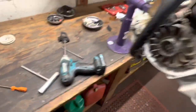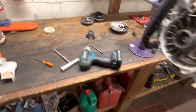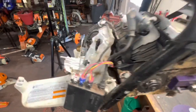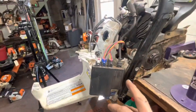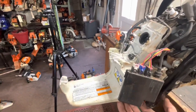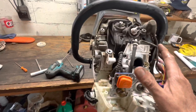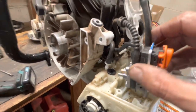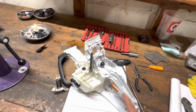Over here, that's just your filter base — couple of screws, pop it out. I only took loose that mount. The two screws right here, there is a small screw from the underside that holds this in place and it just slides right out. I did not have to disconnect any of this. You've got your two fuel lines underneath there. Those get disconnected, and when you buy a new gas tank, you don't get the whole shooting match.